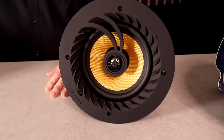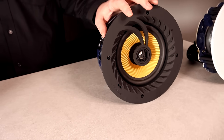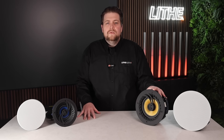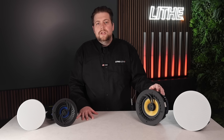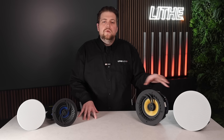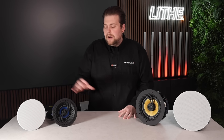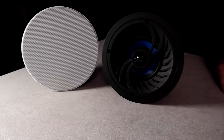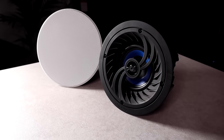For a larger space like an eight-by-eight-metre kitchen-diner where you want both the kitchen and dining room to play simultaneously, that can be achieved with the six-and-a-half-inch version using a feature called Life Link — a physical hardwired connection between masters and their connecting passives, allowing all four speakers to play at exactly the same time. The four-inch doesn't have that capability and is for single installation only; you can only add its connecting passive.